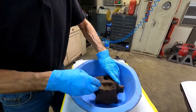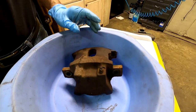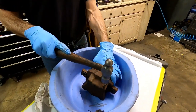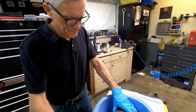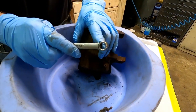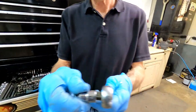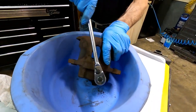First thing you should have done is loosen up the bleeder screw. Sometimes these break off or are seized. To make sure it's not broken off, get a ball peen hammer about this size. Hold the hammer way down here, give it a tap and then whack it — maybe two taps won't hurt since we're replacing it anyway. Now we're going to loosen the bleeder screw. Do not do it with a 12-point wrench; we need a six-point. Get a nice six-point three-eighths socket, and I highly recommend the long ratchet because you never know how tight these are going to be.